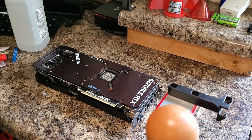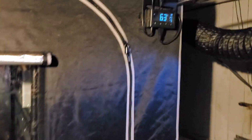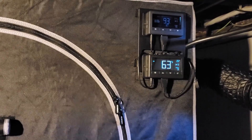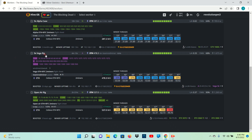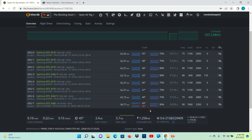I can plug it in and we can check that out. I've had everything up and running for at least a couple of hours now. We'll run upstairs and check the temps on the software. We've been up and running almost three hours now. You can see we're roughly where we were for the other temps — it is a few degrees warmer outside. I would be used to seeing 108 to 110 on the memory, so let's take a look. We're at 96 now — I'd say easily that's a 12 to 14 degree drop from what I'm used to seeing. So you can imagine what it would be like with a full re-pad.